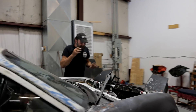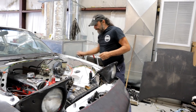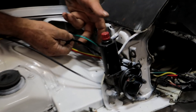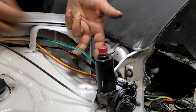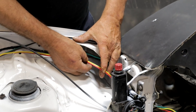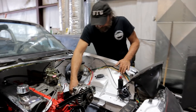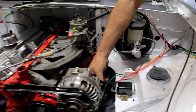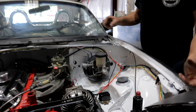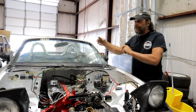Under the hood — last time you guys saw this, we had all the wiring hanging over the front while I was testing it. Now we've got it all routed out the way I wanted it. You can see we've got separate harnesses: this one is for the lights to go up and down, wired to a three-way toggle inside the car. This one is the main headlights and the half-ways. And this one over here is for the turn signals. For the charging system, we're using a Leece-Neville square-back alternator, which has to be run with a separate ground — wired in here — and a point-style regulator. This is all of our charging system wiring, very neatly laid out and easily separatable, so if there's a problem in any circuit I don't have to disturb the whole wiring of the car.